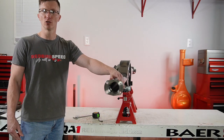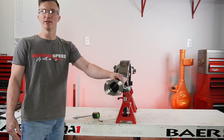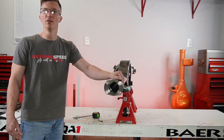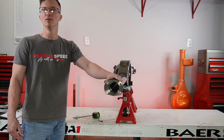By measuring this, you're telling us a lot about your project — brake offset, bearing type — making sure your caliper bracket or your drum brake backing plate will actually bolt up to this. So there's a lot of things going on here. This is a very important step. Measure this up.